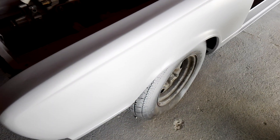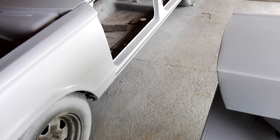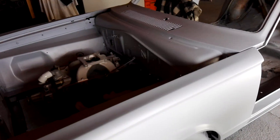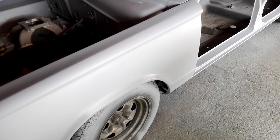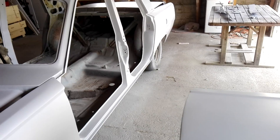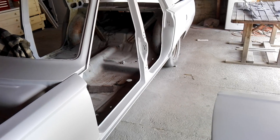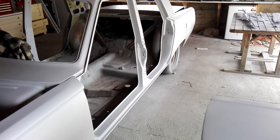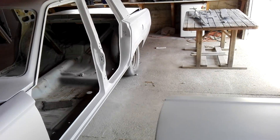I'm going to reshape the front of that, but these are all things that just in the final preps we can massage out. So we're getting real, real close now. The bottoms of these guards I'm pretty happy with — I haven't had a real good look at them since I've primed them, but they won't be far away, hopefully. We'll let this cure up for a good while now, and then I'll probably get back into the other three doors and the bonnet — they're probably ready for a block back. I can sort of leave this for a while and concentrate on the doors and stuff.